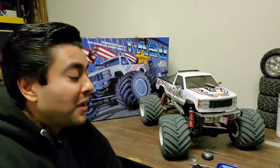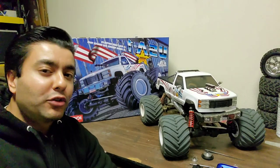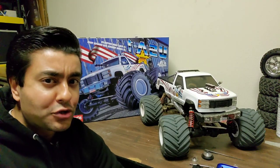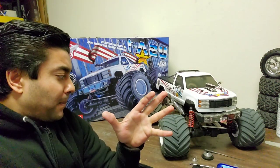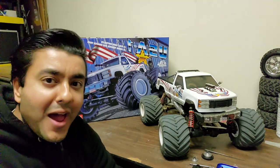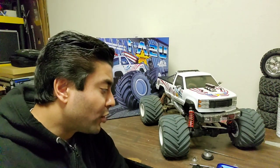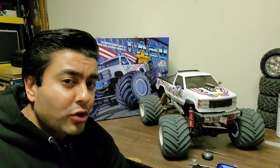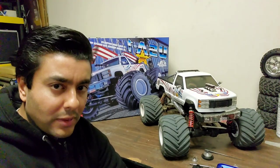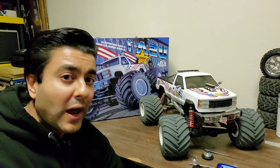Hello, welcome back to my channel, Straight General Facts. I'm going to keep this video brief. As you may have seen from my previous video, this truck's been having a lot of transmission issues among a few other little issues as well. I've been having a lot of fun with this truck for maybe one or two tanks out of the maybe 15 tanks that I've run. We've been having some three-speed transmission problems. From my last video I was struggling to get the thing to shift at all, and then when I rebuilt the transmission and put new gears in — which were stripped — I was finally able to get it shifting both one to two and two to three. Here's some footage of that real quick.